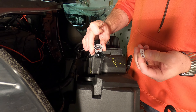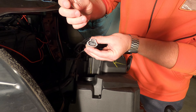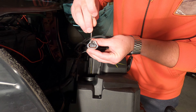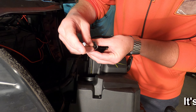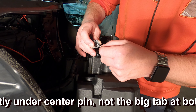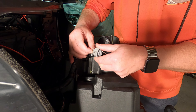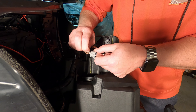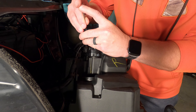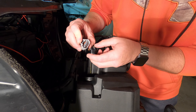That gives you access to the inside. Once you do that, there's a tab lock down at the bottom — I'll take a couple pictures and circle the parts just in case you can't see them well on the video. You have a pin here, a pin here, and then an open slot here. Underneath there is a tab lock. What you're going to do is push down on that plastic tab lock while at the same time pulling that middle wire from the back. The lock you're looking for is right underneath the pin when you look in there.